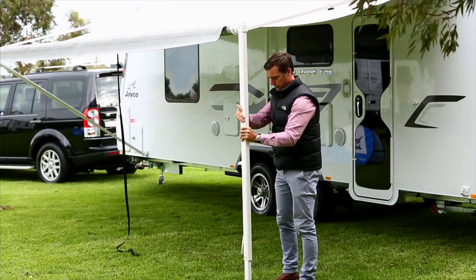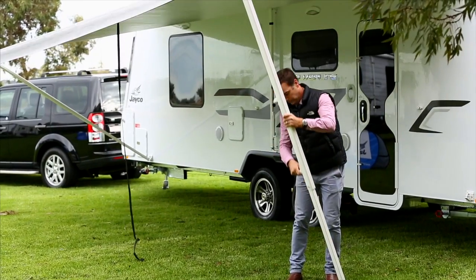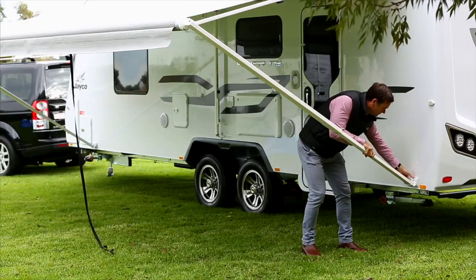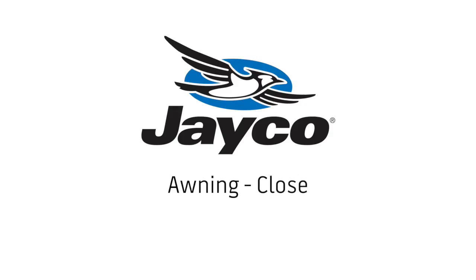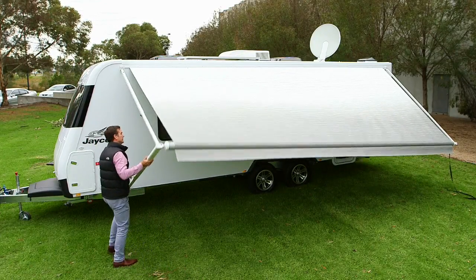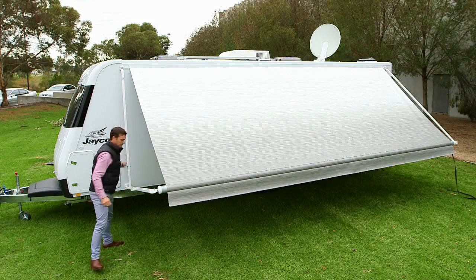To take back to the standard position, swing the arm towards the bracket, lift the handle and lower the main sliding arm until the awning arm foot reaches the bracket. Loosen the top locking knob, lift the handle and lower the arm until it rests on the stoppers. Push the catch so the top arm can slide towards the van.